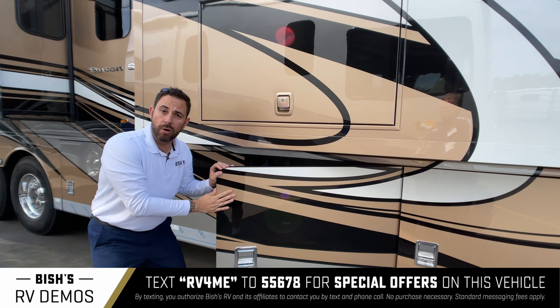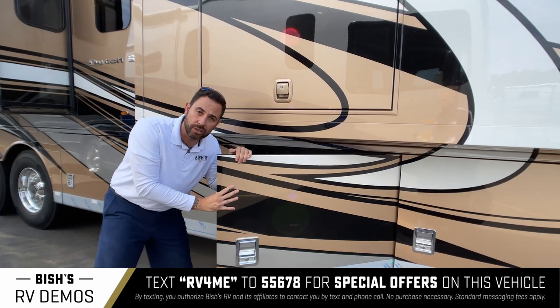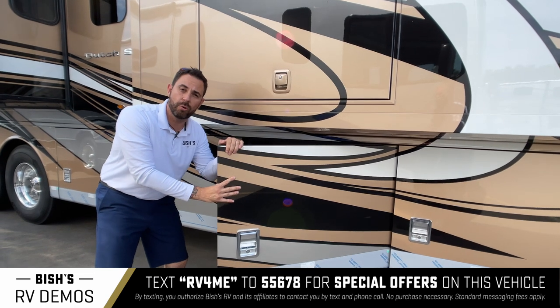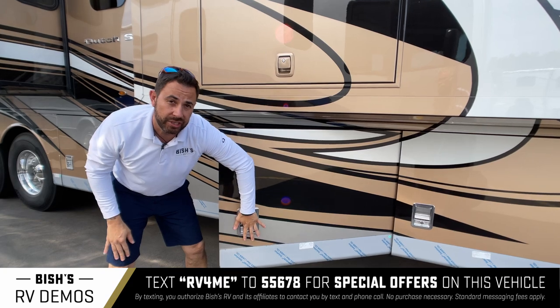Newmar's doors: don't slam the door, don't do it that way. What you want to do is slam it from the actual latch. It's got T6 aluminum, and the actual seals around these doors are very tight and sensitive. So slamming it from this latch will give you that better seal for the close.